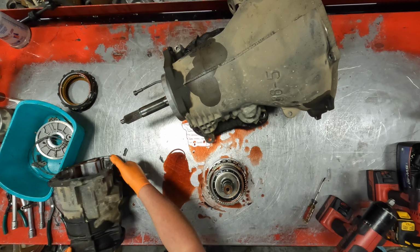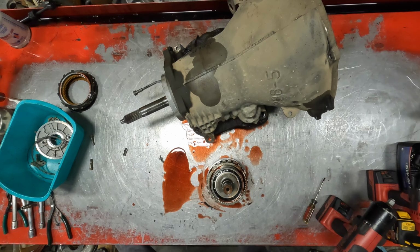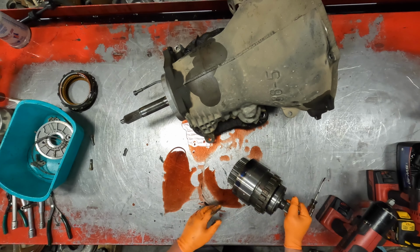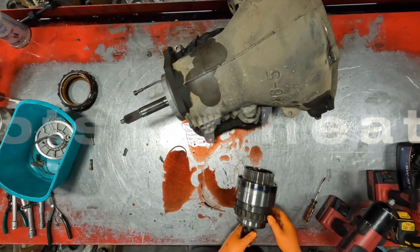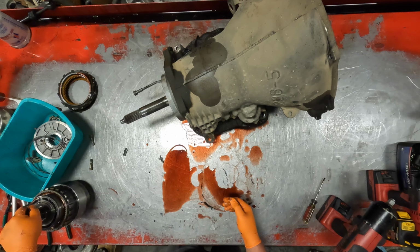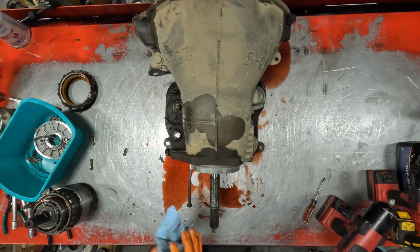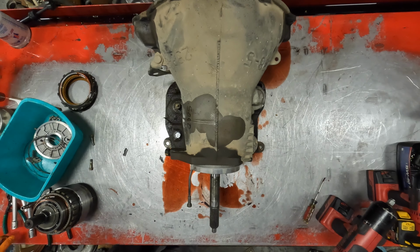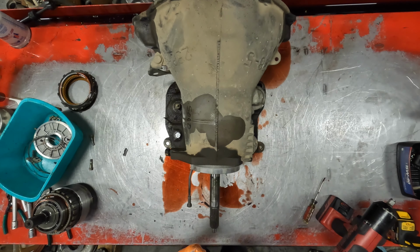That is your rear tail housing. Set of clutches in there. Yeah, boy, you can already see it. Black and blue. Yep. So that's why it doesn't have reverse. But while we got the camera rolling, we're gonna go ahead and disassemble it just to show others what's inside here. How to disassemble, right quick.